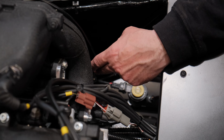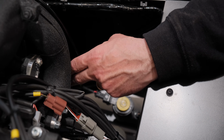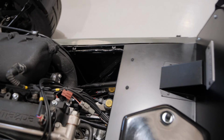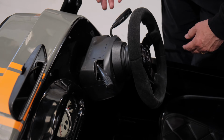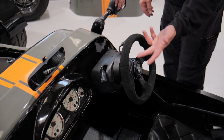The steering link bar, which is just on this side here, this is one we modify. This is a collapsible one and required for UK IVA compliancy. This particular one we modify for you, so that's why it's important you have that, and that moves all the way through to a familiar steering column, as you will see, which has all the donor components for wipers, and then your horn will be in the centre there.